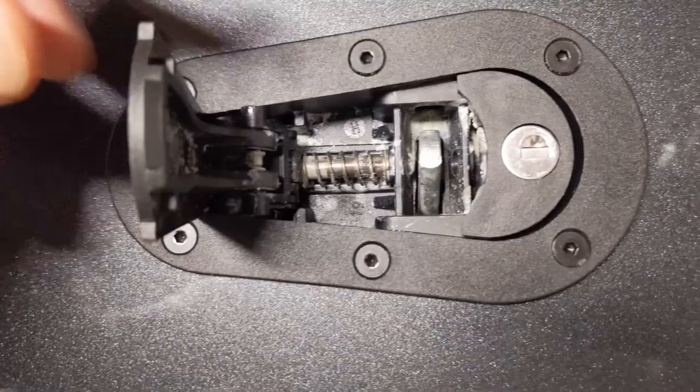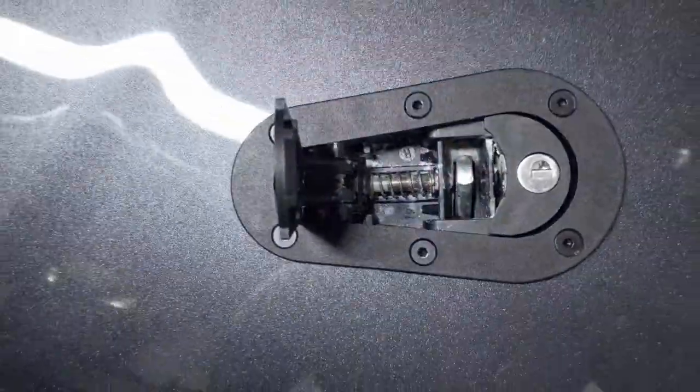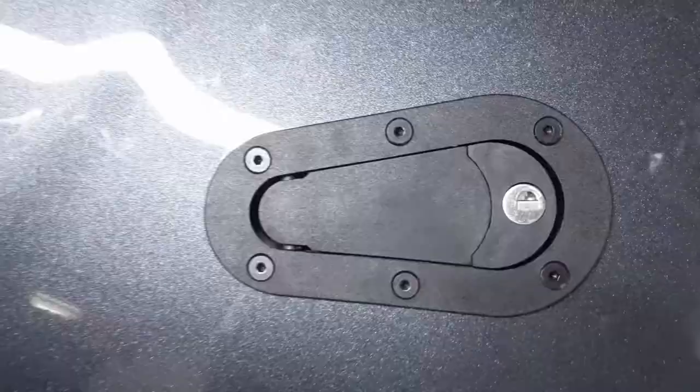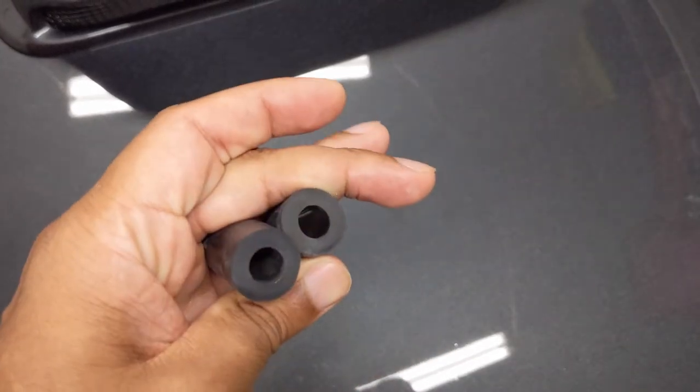I put a little grease on the metal parts of the latch and then applied a UV blocker coat on the outside of the latch to protect the plastic. After that, the install is complete and there is no movement from the hood. The kit does come with rubber bump stops — you can place them on the anchors if you feel the need.